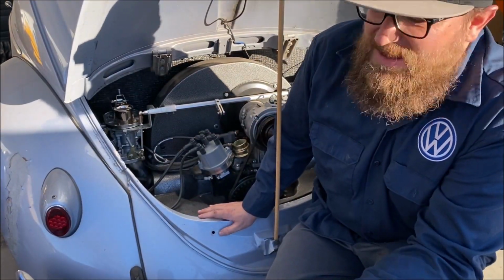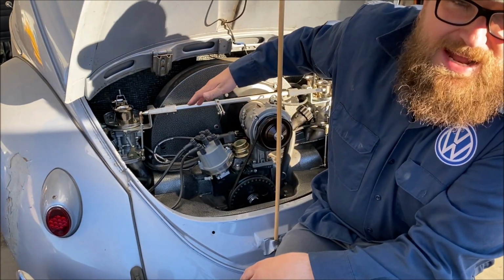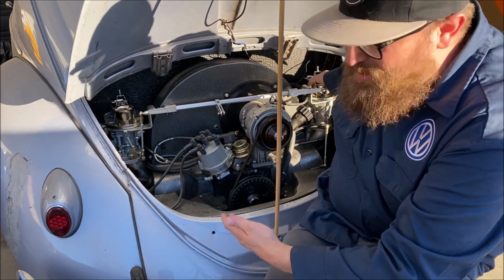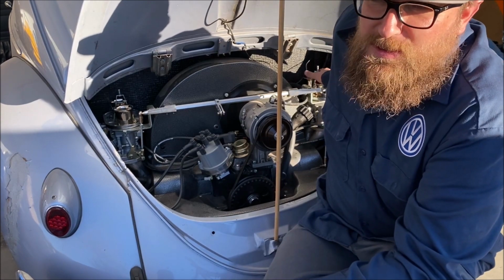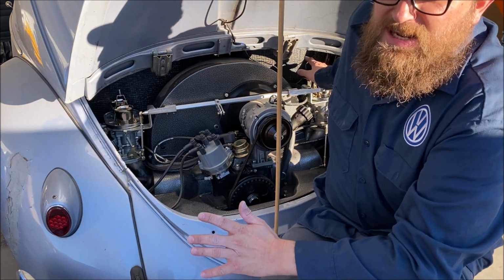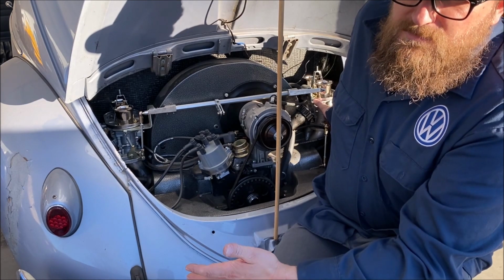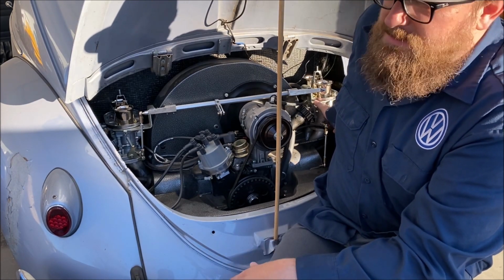I don't recommend doing that. I didn't run the car very long, but it did help me isolate what's going on. Clearly, the passenger side carburetor, the one that was dumping fuel at one point because of the possible issue with the float, now seems to be functioning halfway normal. When I touch any of the adjustment screws, it does affect the way the car runs.